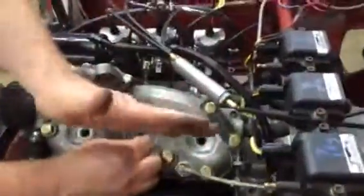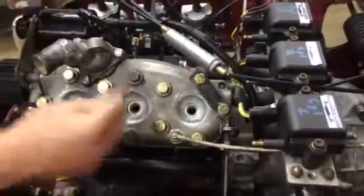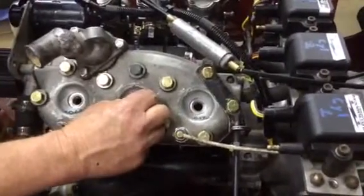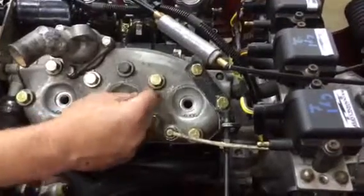You want to go even with the wrist pin, so I always want to check like this. I've got to get my angle set, so I come in and hit the sidewall straight. Then I'll just take and roll the piston up — you see the solder lift — spin the engine over, boom, I got my squish.